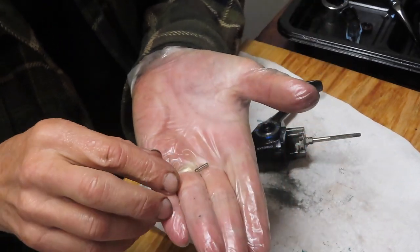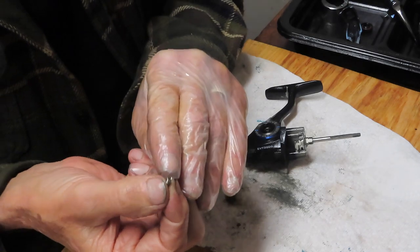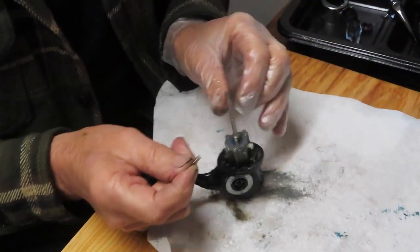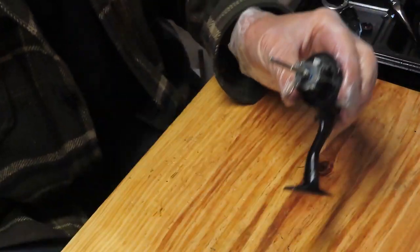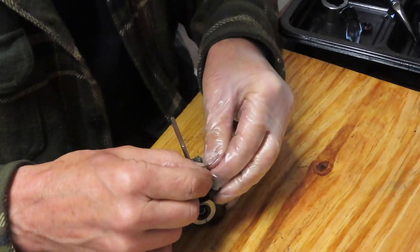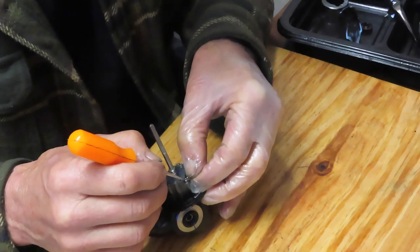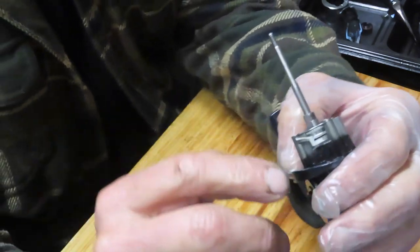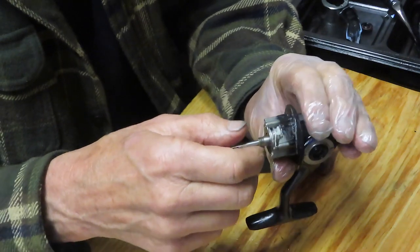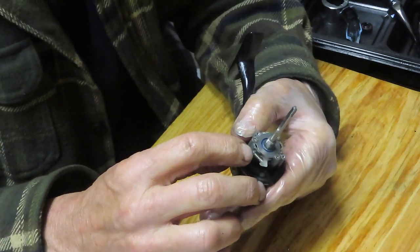We have that anti-reverse spring. This is interesting — it's a push spring rather than a pull spring. One end hooks over the terminal, the other has an open end with a corresponding little insert. Remember, it jumped off here, so it should load like that. You've got to be careful not to shoot this spring. It's actually pushing that assembly out — and as you're turning it's fine, but as soon as you go to backpedal, it holds that assembly in place. That's an unusual design.